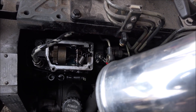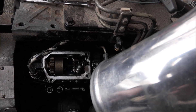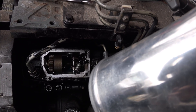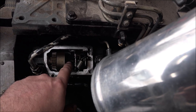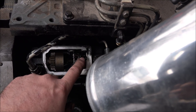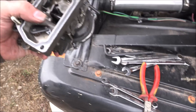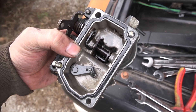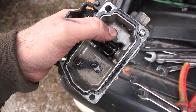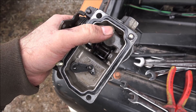I got the top off the pump down in there so I can inspect it, and I found the governor appeared to be frozen up. I've gotten it freed up where it's working. I'd say it's where it sat with no fuel in it — it just gummed up. They didn't have the indexing right on the throttle linkage either, so I fixed that. And the AFC control — that little pin down in there — it was frozen up and it wasn't working either, so I've gotten it freed up.